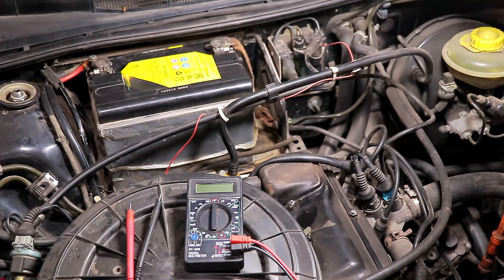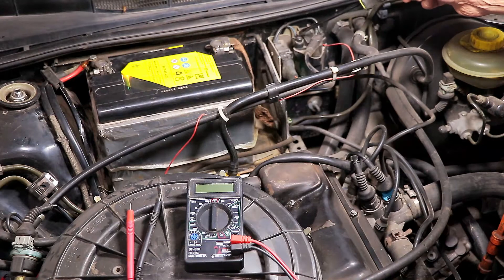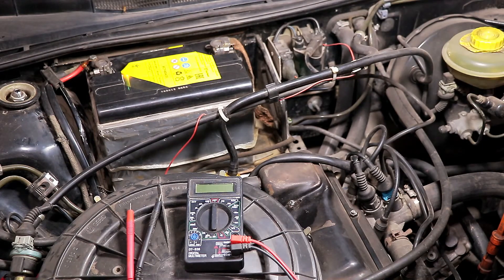But the main problem is to determine which one of the two ignition coil leads is the supply. Because on the second lead, which is connected to the ignition amplifier or ignition commutator, there are voltage pulses with an amplitude of near 300 volts. This is a very high value and these pulses could damage the TPS. So we must determine the correct lead of the ignition coil and connect the supply there.